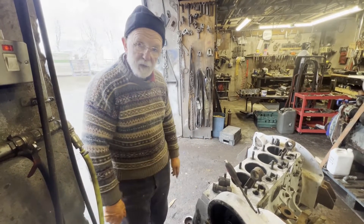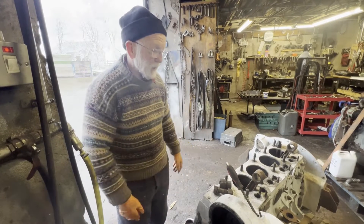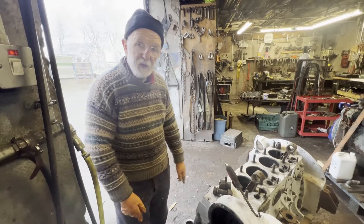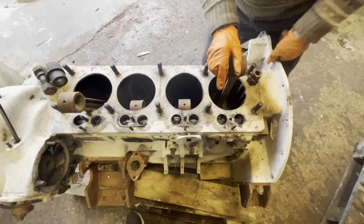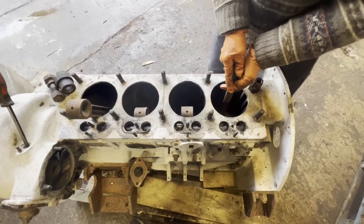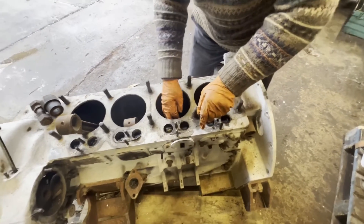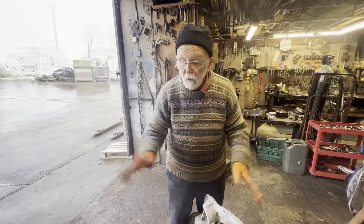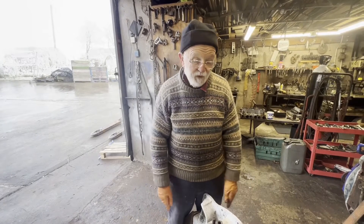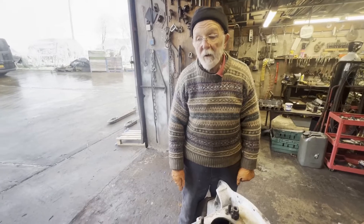That's as far as we've got with that engine. What we'll have to do now is take out the crankshaft and measure the big ends and the journals and see what condition the crankshaft's in. At first sight it appears to be not too bad — it's just definitely not seized. There's no vertical movement; I cannot pull that con rod up and down, it's really quite tight, and they're all the same. The camshaft we greased some time ago, so it's perfect. We should of course get a new cam and chain and so on, but all this work is wasted if the crankshaft is out of tolerance. There's nothing else we can do — whether it will all be worthwhile at the end or not, I don't know, but I think it will.